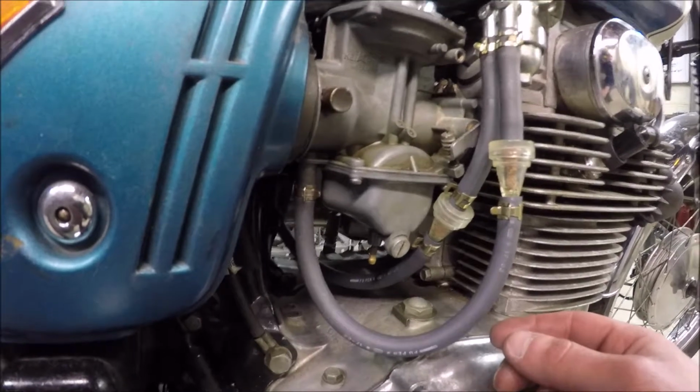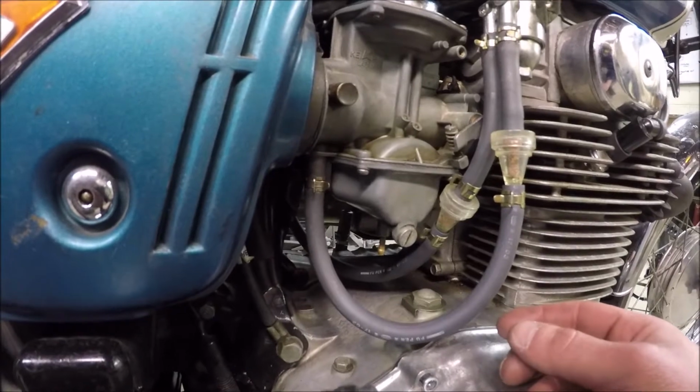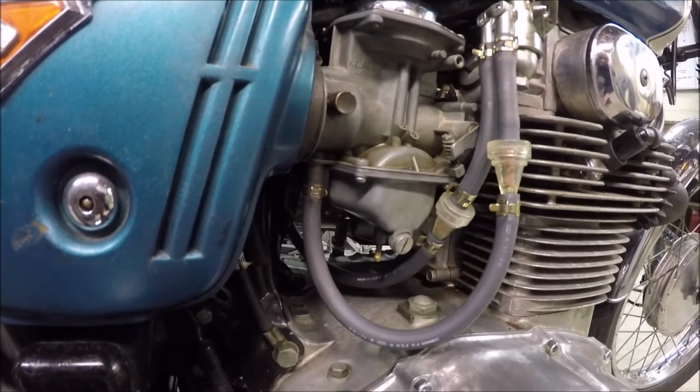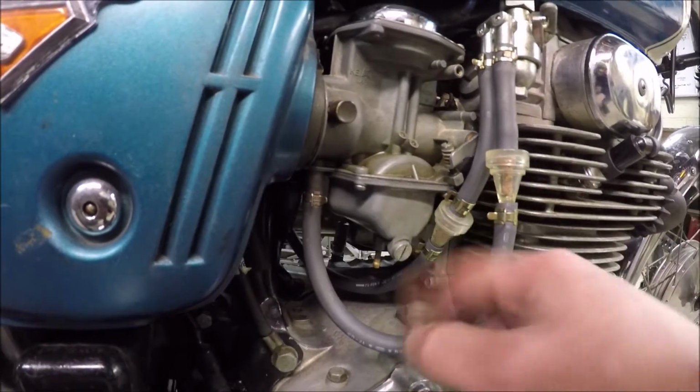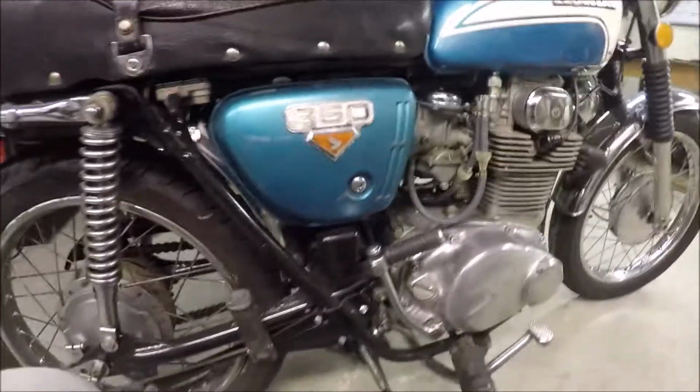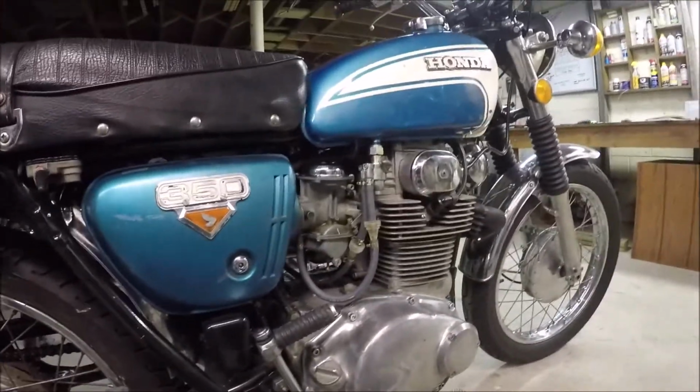If not, then, I don't know, then it's better. But it's going to have to prove it to me over a couple times, because it's worked 1 week and then all of a sudden it starts sticking again. The other thing I could have done is made it way too lean now. Lean as in I dropped the fuel level too low. But it's a lot of work to move something 1.2 millimeters, but that's what we're trying.